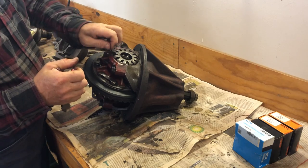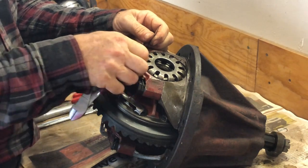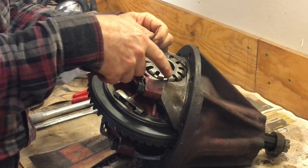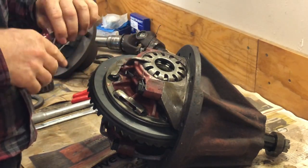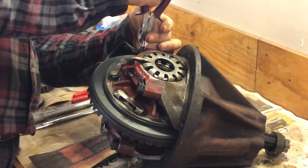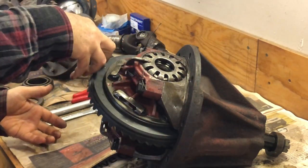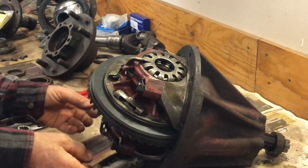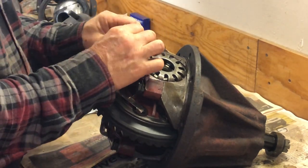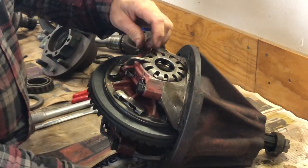So we just cut this lock wire — that's pretty easy. The lock wire holds this pin in and it can be bent and locked to hold this cage in any position you want. This cage and the one on the other side screw in and out so you can adjust the crown wheel going in or out from the pinion to take up the slop. So I just have to pull it all apart, clean it, look at the bearings, put it all back together again and adjust it.